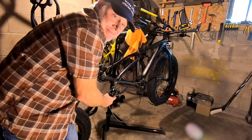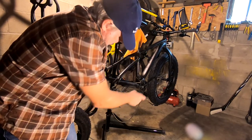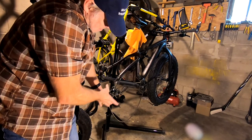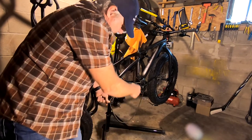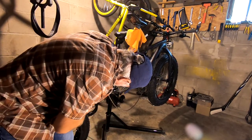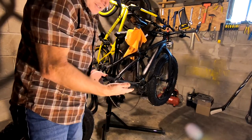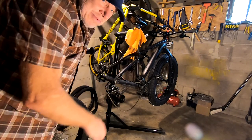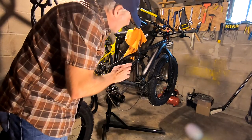I'm hoping this is going to work — this is kind of a medium-length derailleur, so I'm hoping it has enough range to go 1x10 with that big 46 tooth. I believe it will because if it can handle the big ring up front and the big cog in the back, it should have the range. This is even carbon — X9 is actually pretty high end for the SRAM line, and XO is the top line. Now they have a different system with GX and NX and all that, but I like the X9 so I'm going to keep it.